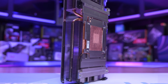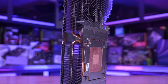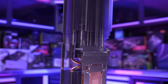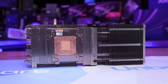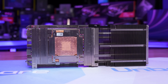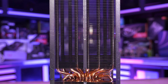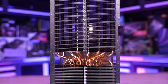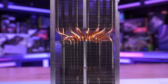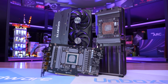As for the cooler itself, it weighs 1540g, and that means almost 80% of the graphics card's weight is in the cooler. With the fans removed, the weight of just the heatsink comes to 1,183g. At the heart of the cooler is a large copper vapor chamber which directly contacts the GPU die, extracting heat and feeding it into the 10 6mm copper heat pipes soldered to its surface. Also connected to the copper vapor chamber is an aluminium heat spreader that connects to the GDDR6X memory, and there are also heat spreaders used to interface with the VRM components. It's an impressive cooler — quite a simple design, but impressive all the same, and it appears to be well-built.